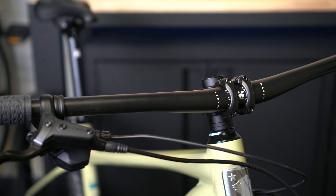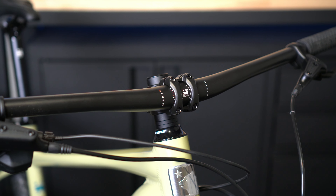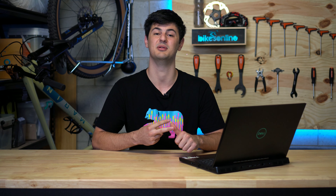When it comes to bang for your buck, nothing quite beats upgrading your contact points. While your tires connect you to the trail, how you connect with your bike is just as important — that's going to be your grips, saddle, and pedals. Most budget bikes really get this wrong, but things are getting better. A perfect example: my Marin Bobcat Trail 4 came with a short stem and wide bars — 780mm wide bars and a 45mm stem — which really puts you in a confident position on the trail. A wider bar and shorter stem gives you more stability on the descent and a bit more control too.